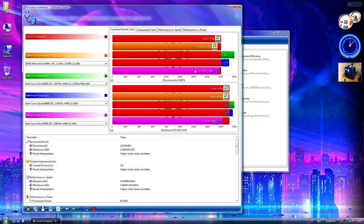I don't like the Core 2 Duo though, really, because they lack integrated memory controllers. I just feel the whole platform is kind of old. The only thing good is the fact that the CPU is actually faster, which you could argue is the only thing that matters. But yeah, I like the cleaner way the AMD platform is designed. No denying the Core 2 Duo is the faster one, and it overclocks better. But the K8 at this point is a very old CPU.